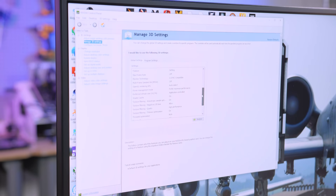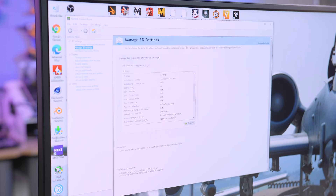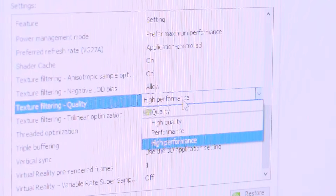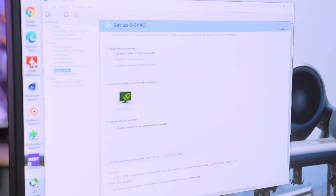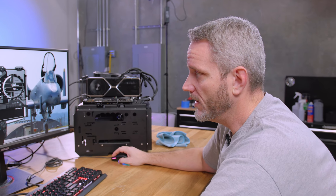You want to go into the 3D control panel settings for NVIDIA, go to Manage 3D Settings, and come down to Power Management Mode — set it to Prefer Maximum Performance. This will keep the core from throttling down so much; it'll pretty much stay at its boost clock most of the time. We also want to turn Texture Filtering Quality from High Quality to High Performance. This usually picks up a couple percent in performance when overclocking. Also make sure G-Sync is off.